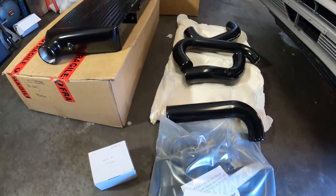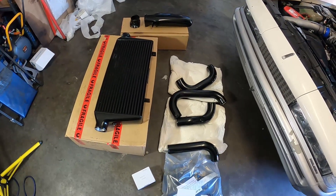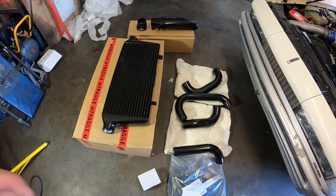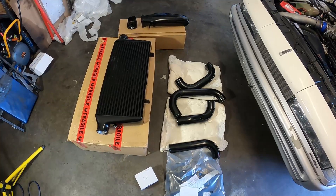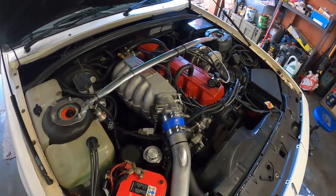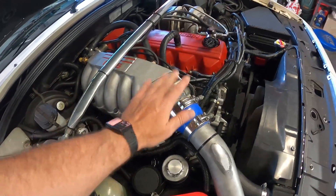That's pretty much what you get. It costs a lot of money, but this is something I've been eyeing off for years and I'm pretty stoked to finally have it in my hands. The car's making pretty good power at the moment, but on the intake side of things it's heavily restricted because I'm running the factory non-turbo inlet manifold that's been cut and shut with the forward-facing XF plenum.